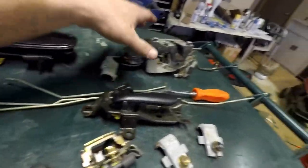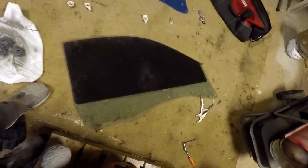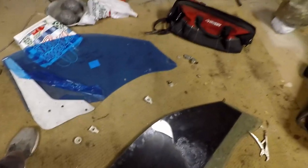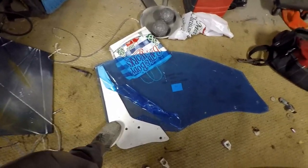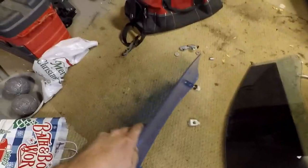There's the door handle, striker, and all that stuff. There's the stock glass — you can see all the holes for the window. This one has them perfect. With this plate on, I need longer bolts, like five millimeters longer, because they only grab just a thread. The stock glass weighs 11 pounds; this Lexan one with the metal brace is 5.5 pounds, but the thing is pretty flimsy. I can feel it — maybe can't see it in the video — we'll see how it does on the car.